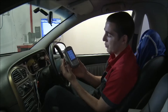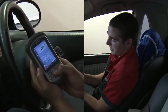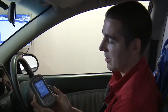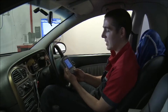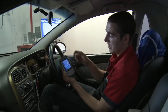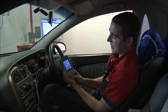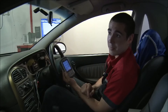This is a hand controller, so I can control everything I need to from inside the car. Some of the main functions: speed — you can go up and down in 10 kilometre increments, or one kilometre increments side to side — which allows you to very accurately hold an RPM and load point, good for engine mapping. To do a basic power run, you get to the RPM you want to start at, hit load, hold your foot flat to the floor, wait a couple of seconds, then hit ramp. That'll run the car through a predetermined ramp speed in kilometres per hour per second. At the end of the run, you back off and hit the load hold button, which holds a steady load to bring the RPM back down.